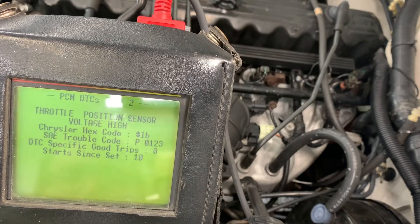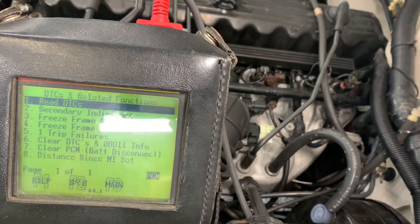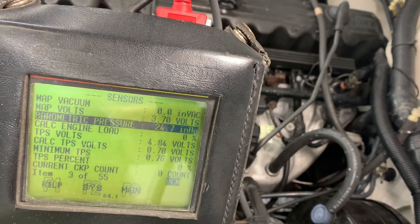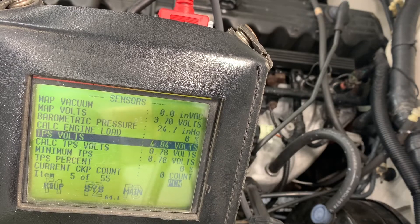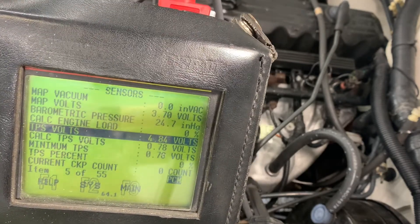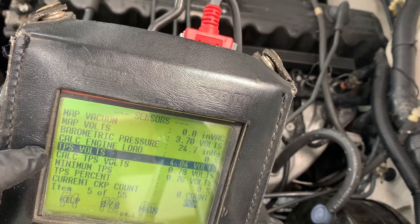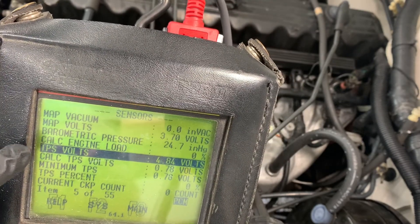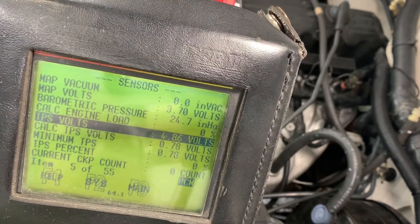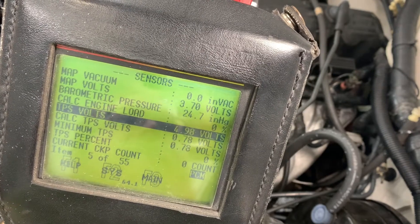There's definitely something up with it. I'm going to show you a little bit of troubleshooting we can do besides just replacing it. If I take a look at the sensor raw data, you'll see here's my TPS volts, my minimum, and my percentage. See how my percentage is reading zero percent — I expect that because it's sitting off right now. But I do expect it would change when I open up my throttle. The TPS volts — from previous experience I know this is too high — it's reading basically five volts, which is the maximum supply. These are all five-volt sensors, so that means it's returning a hundred percent of the supply voltage, which is not correct.